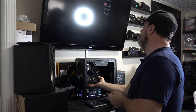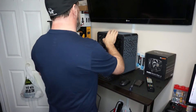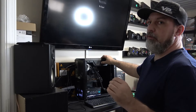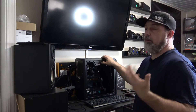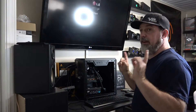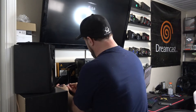There should be nothing on screen, so we're going to go ahead and remove the video card entirely to confirm that. What we'll find out is: maybe the 3400G or 3200G will work as a regular processor but not as an APU — and that's exactly what we're here to find out.